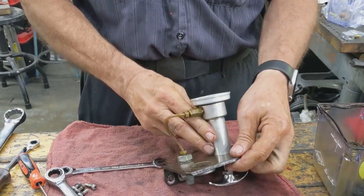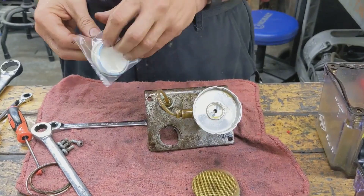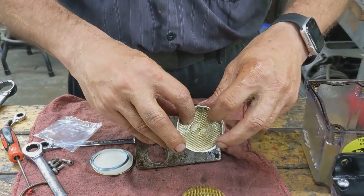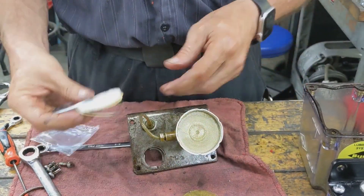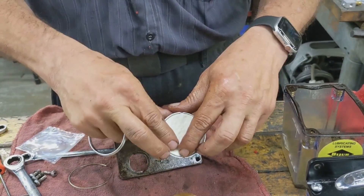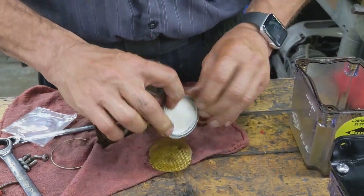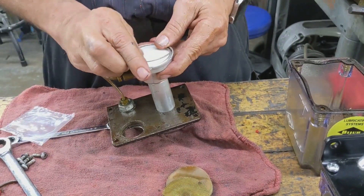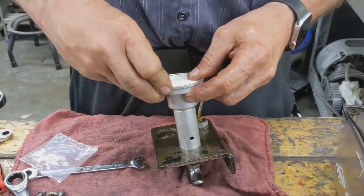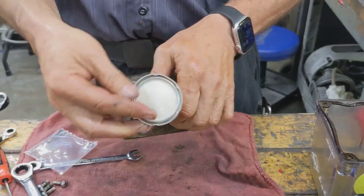Now we're ready to put in our new filter kit. Take your filter kit out, open it up. If you recall how we did it the first time, it goes exactly in the opposite way. I have a habit of always laying it out so I know exactly the direction everything goes. You put your big screen in first — it's much more sturdy than the fine one, and the fine one will go in last. Your fine one, your felt. You put in your metal ring with the V kind of going down in there like that. And last step, we put in our metal ring. Your filter is now in correctly.